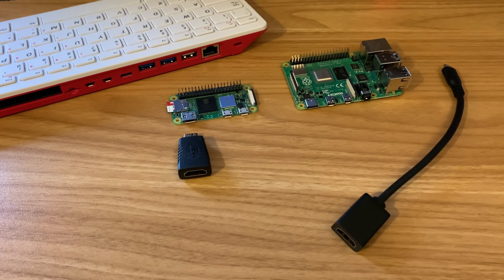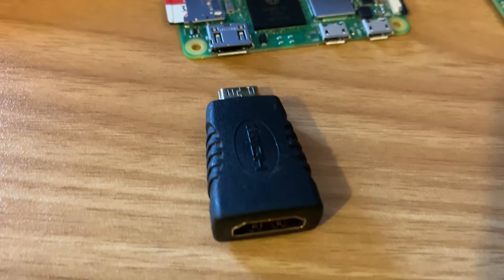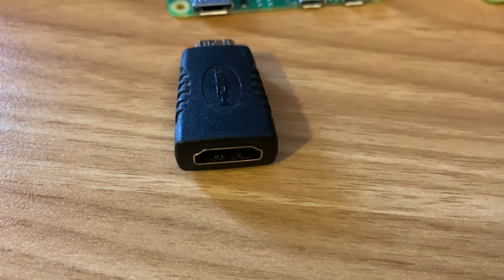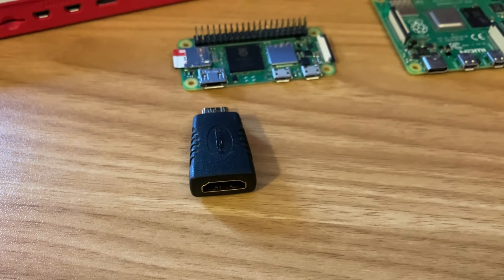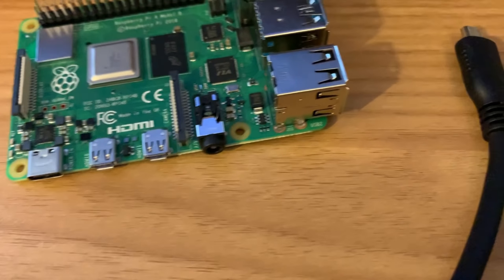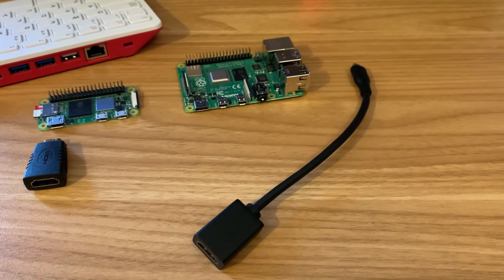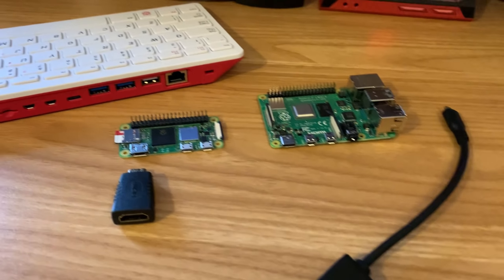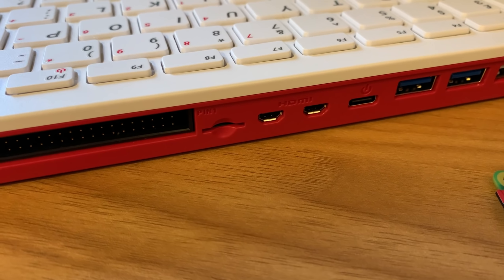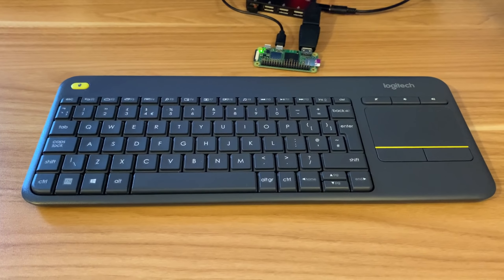Most people won't have the right HDMI cable for a Pi 400, Pi 4, or Pi Zero 2W. The Zero 2W uses mini HDMI, so I recommend a mini HDMI to HDMI adapter since most people already have a standard HDMI cable. The Pi 4 uses two micro HDMI ports — you only need one — so micro HDMI to HDMI adapters are my favourite. The Pi 400 has the same video connection as the Pi 4. You'll also need a mouse and keyboard — I recommend the Logitech one with a dongle and trackpad, which works great on a TV or desktop.